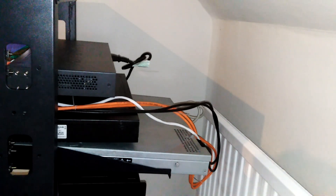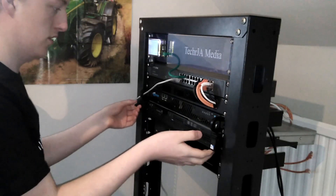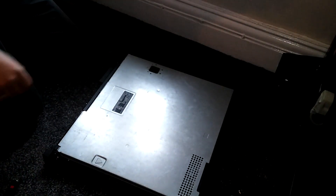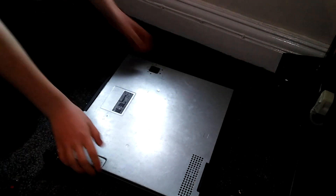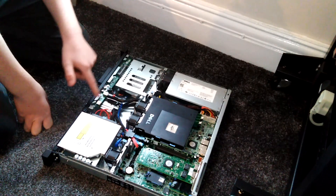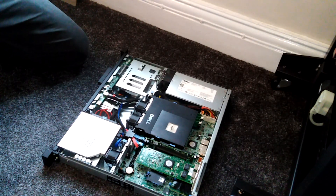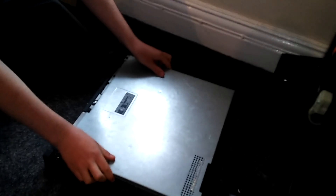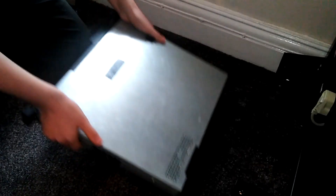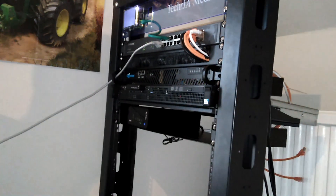To do this it requires me to unplug everything on the back and that should slide down. I'm just going to unlock it. The thing with these servers is that you can put the USB drive on the inside, because they have USB ports on the inside. So we're going to be using that to put ESXi on the system. I'm going to lock it and put it back in the rack.